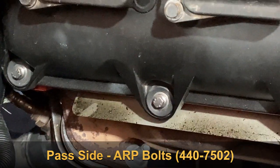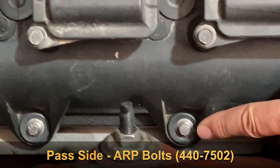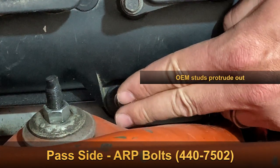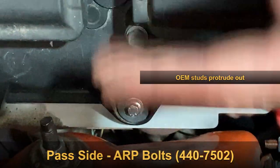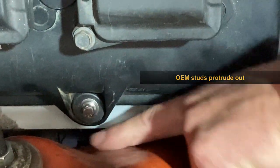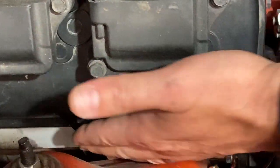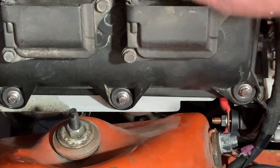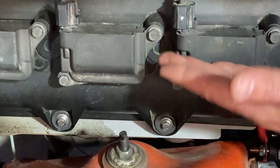Also notice right here — it's a very tight point. This was another purpose for the hardware: with that stud sticking out, it was in very close orientation to the inner shock tower. As the engine rocks and vibrates when driving and applying some throttle, it could make contact and chip your paint. In a show car that may really concern you, and getting your hands in this area could harm you. So it solves those two problems: it uniformly loads the valve cover down on the cylinder head and it prevents leaks such as this.